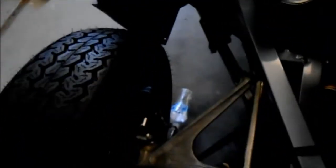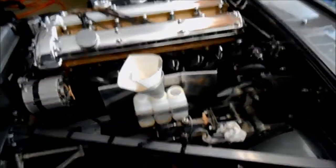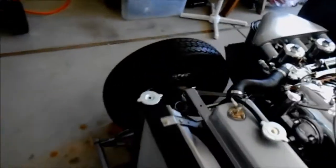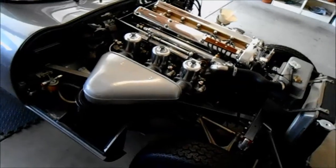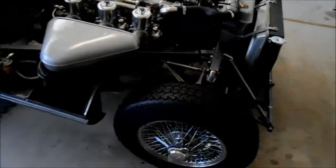I also put some fluid in my front brake reservoir and I was gravity bleeding the front caliper on one side, which worked. I've opened up the one on this side and I'm letting that one dribble a little fluid — letting gravity do some of the work so I don't get carried away. I went and bought myself a set of Harbor Freight flare nut wrenches — a cheap set. I wanted a nicer set but none of the Sears stores had Craftsman in stock and I wasn't ready to pay $25 a wrench, so I got a set of six from Harbor Freight for $12.